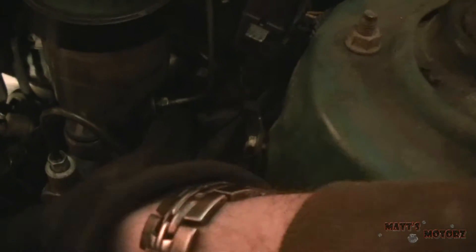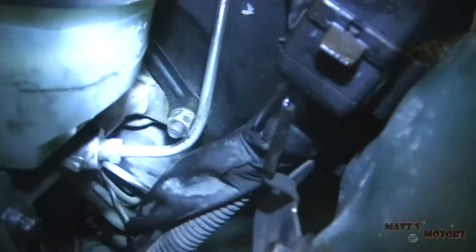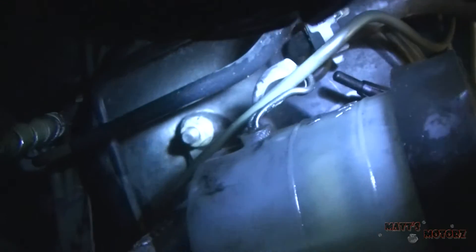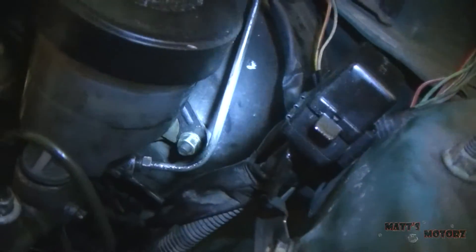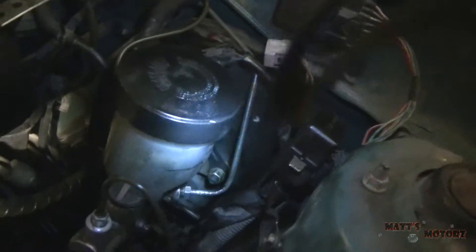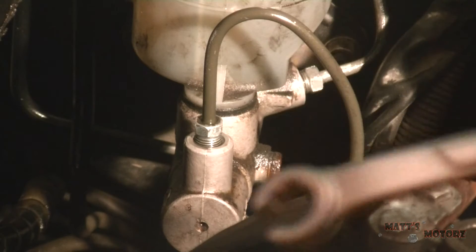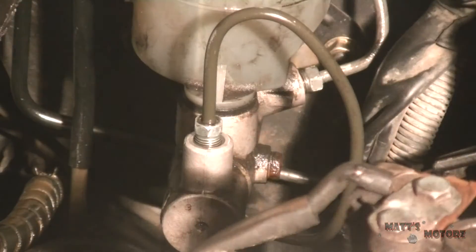Here's the plan of attack: first we're going to remove the brake lines — there's one here and one back here. We're going to remove those first, and then in the back there is a bolt on each side, right there and right there. Then this master cylinder will come out. Always use a flare nut wrench to loosen these lines.